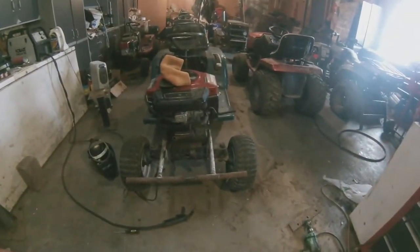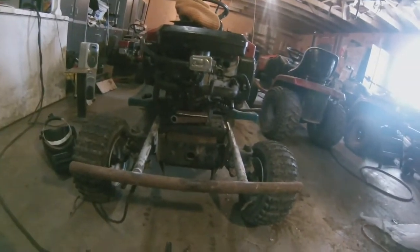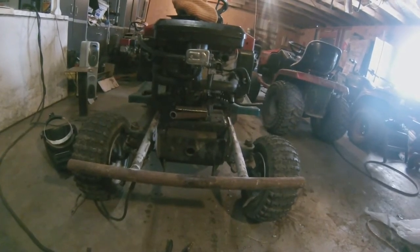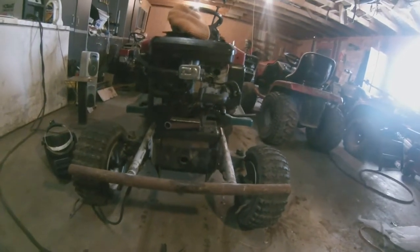Now the bumper's starting to take shape. It doesn't really look level right now, but it is. The problem is that this front axle is supposed to pivot, and as this thing was sitting out in the woods for several years before I got it, it's kind of rusted at the angle it was parked on because it was on a slope, so I'll have to free that up.